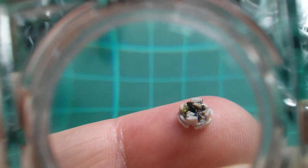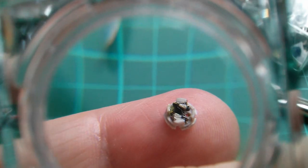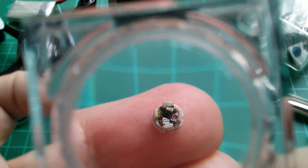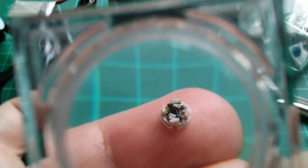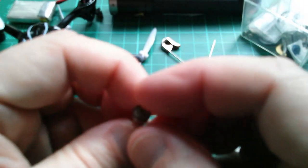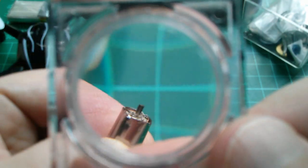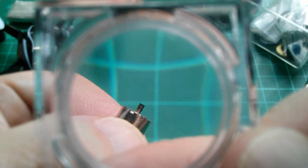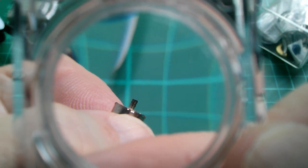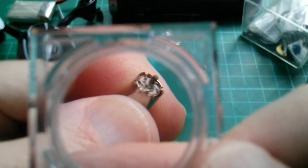Things are disintegrating — oh, that's got it! I think I can see brushes in there, and grease, but I also think I see solder. So it's possible the wires are soldered in and they don't just unclip neatly. So fitting new wires to this is probably not going to happen. Yeah, I think that's the commutator — a number of different bits of metal there, and those are the brushes. So it's a standard DC brushed commutator-based motor.